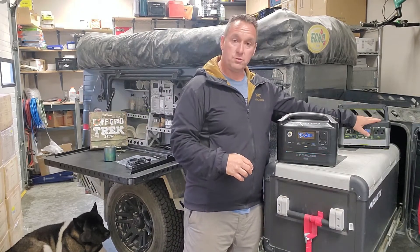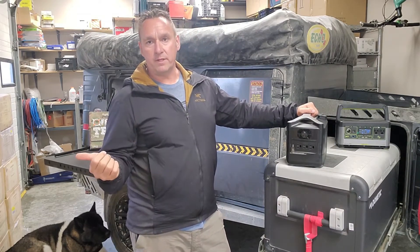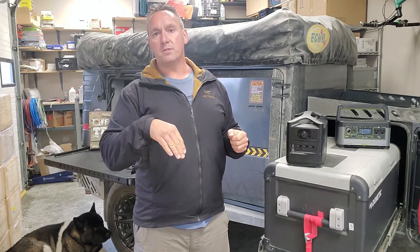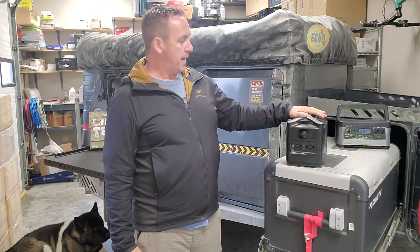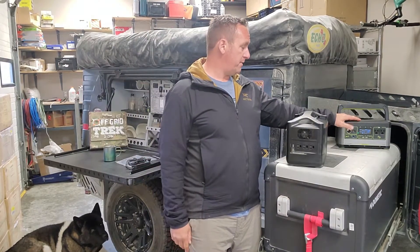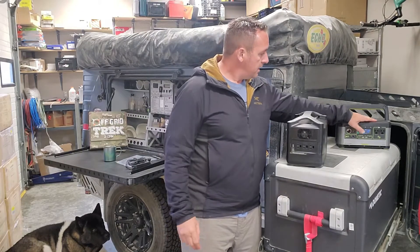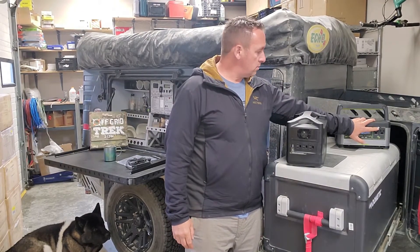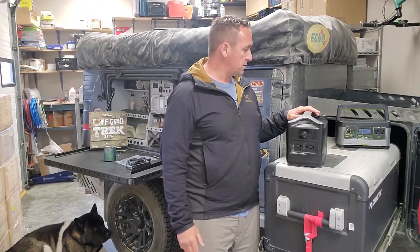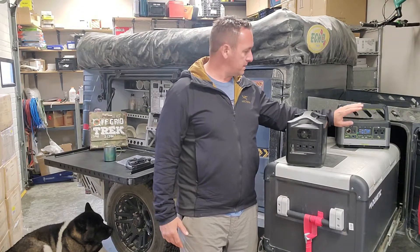Back to why I don't believe the Goal Zero offers a full 1200 watt surge. In two tests — the fridge at home with dual French doors and a freezer below — the EcoFlow ran it beautifully for five and a half hours with its 576 watt-hour capacity. I was expecting around four and a half to five hours from the Goal Zero's 505 watt-hour pack, but within 30 minutes to an hour, when the compressor kicked in, the AC light turned red, it tripped, and it wouldn't run the fridge. I ran it three times total — it just wouldn't run the fridge. There wasn't enough power, so I was quite disappointed. This cannot be relied on for emergency preparedness because of that.